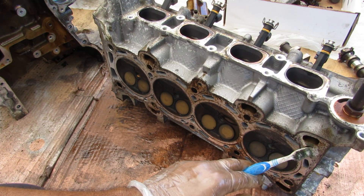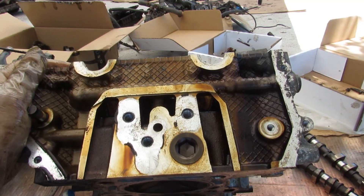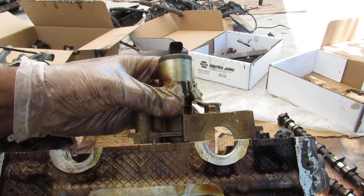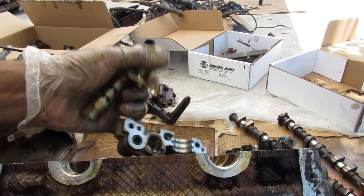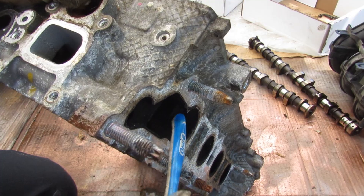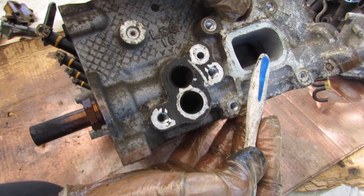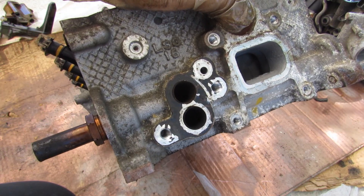Taking a look at the engine head, you can see through these dowel pins is where the oil feeds up inside of the engine head — and over here for the variable valve timing system. The VVT feed comes up through the bottom, then goes up this way, across this way, and out to this port on top of the head. This variable valve timing piece sits over here on top of this head and takes some of that oil through this oil control valve, controlling the amount that goes through this channel to feed the variable valve timing gear. Over here on the exhaust side of the engine, some of the exhaust coming off of cylinder number four is snaked around back through this port and pushed in through the head, then travels through this water jacket where it gets cooled down, then passes the EGR valve which controls the amount of exhaust gases recirculated back through the intake.